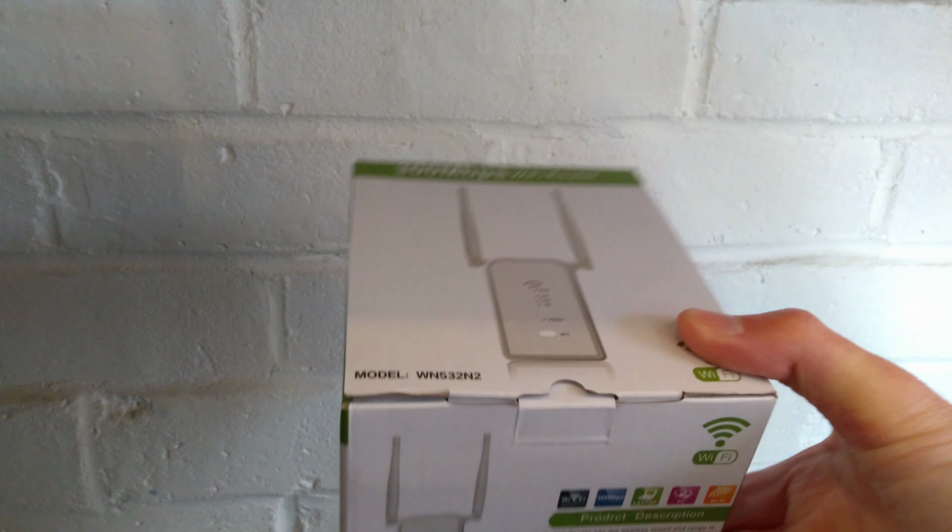Wireless basic settings gives you a weird inline tiny box where you can type in the wireless name and set a password. The WAN basic settings lets you set static IP address, DHCP client, PPPoE or PPTP, which is a point-to-point tunneling protocol. You can also set attain, don't know whether that's supposed to be attain or obtain, DNS automatically, or you could use static DNS and set OpenDNS or Google or 1.1.1.1, etc.